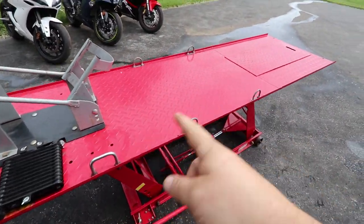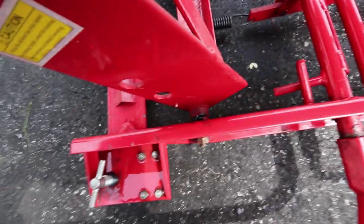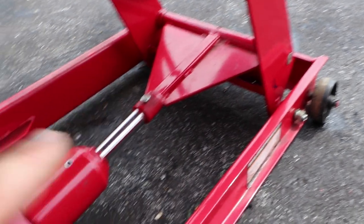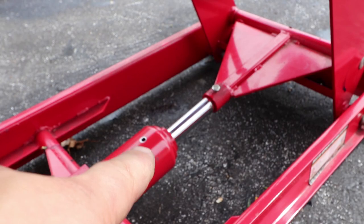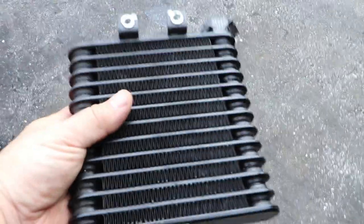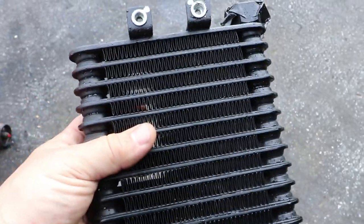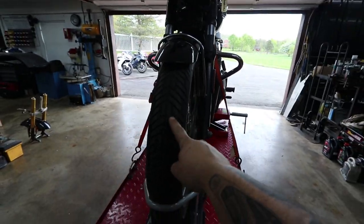The lift is completely wiped down and dry — it actually looks really nice. There are grease points on all the sides at all the pivoting points, so I greased all those and topped off the hydraulic cylinder with fluid to keep it in tip-top shape, making sure to get rid of any bubbles. I also washed the fins, straightened out a couple, and pulled all the little rocks out with picks. Just have to pull the tape off and she's ready to be installed.